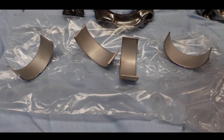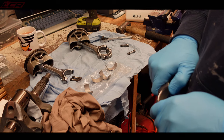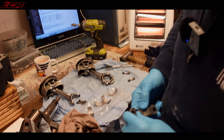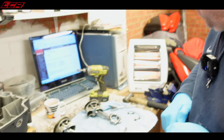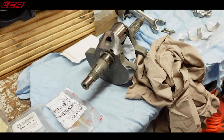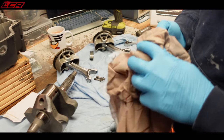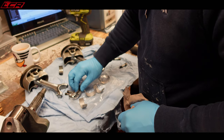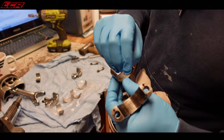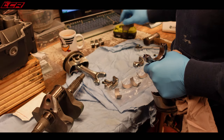Conrods - we've got to fit new bearings into the conrods. I won't give any technical details, I'll leave that to Nelly. So we think we've got an A crank - there's no markings on it unfortunately, but prior to me cleaning it when I did all the plugs, there was a faint remnant of a painted A, so I'm hoping that's what we've got. We're going with blue-blue on the shells. The plastigauge confirms that it's right though - that will confirm our clearance. The reason you do the plastigauge is to check you've not got any significant wear that's going to affect your oil film gap. The white metal coating on the bearings goes first, then you get through to the bronze. If you're unlucky enough to go through the bronze, it will get to the steel and then you'll seize.